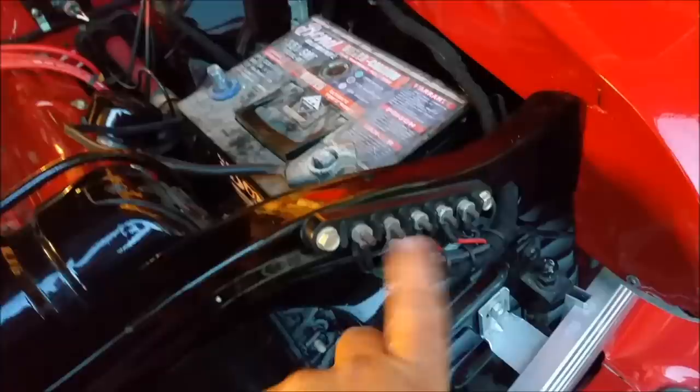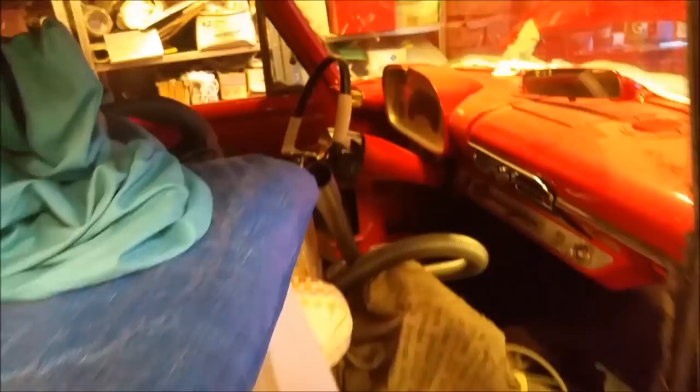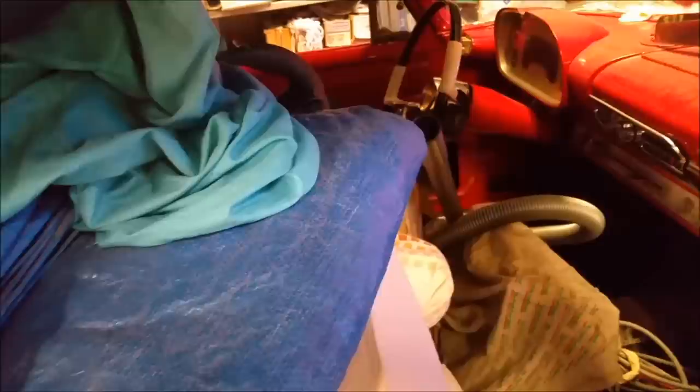I would repaint in the boot. They're normally a primer colour anyway, and I want to rewire. That's all hard as rock. But if you remember all the engine bay wiring I redid a few years ago, and I retained all these blocks and all this, and I wrapped it in the fabric stuff. So all in the engine bay and in the cabin is rewired. There's a loom, and I put fuse boxes in it too, because it did have circuit breakers, which are still in the switches, but I wanted to give it a bit more protection. So it's rewired up to where the A-pillar is, and then there's another loom that takes off and goes down the back, which is quite easy on this car because there's not much going on in it.